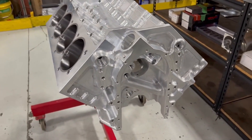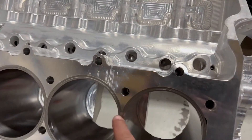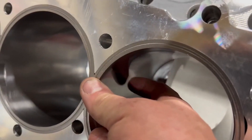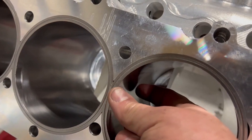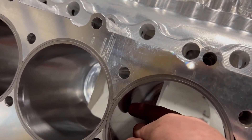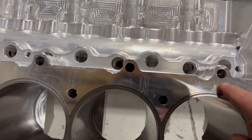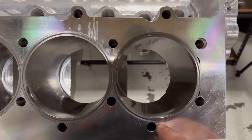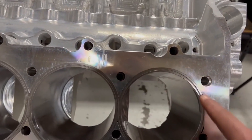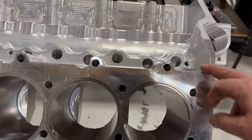These sleeves are done differently. The sleeve is this thick at the top — not just a step — this step is actually two inches down into the cylinder, so the entire high-pressure area at the top of the cylinder has the thickest sleeve possible. From about here down, the rest is a normal thin sleeve. Also, nowhere in the block — except at the head bolt holes — does the material measure less than about three-quarters of an inch, maximizing rigidity in the cylinder bore itself.